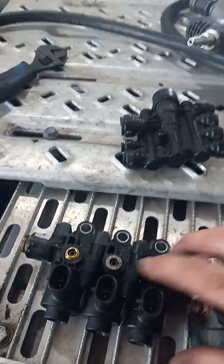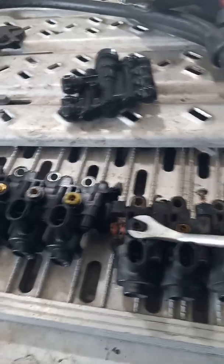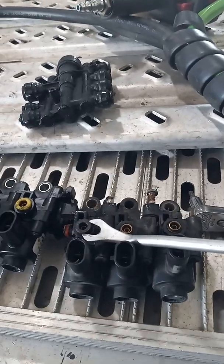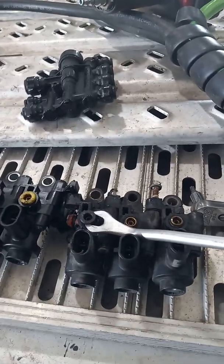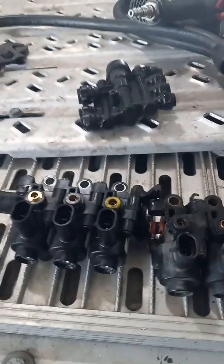The new actuators don't come with the plastic covers. I just wanted to show you — if you go to Harbor Freight or have one of these door panel remover clip tools, it slips right under there and they pop right off. Then you can click them right onto the new one. Already did two of them, so we're ready to go back in.